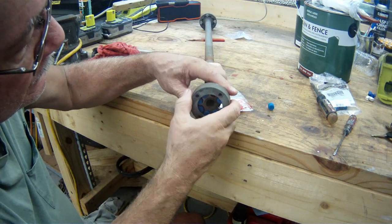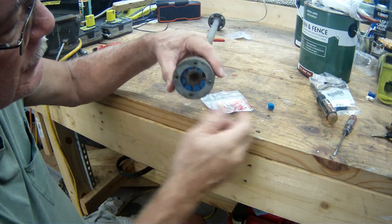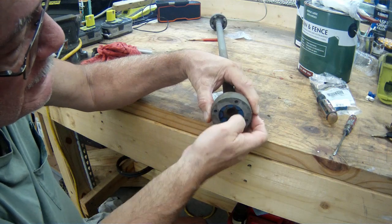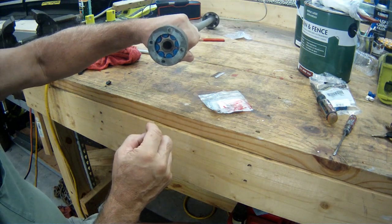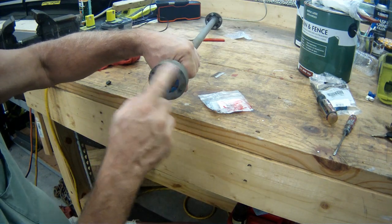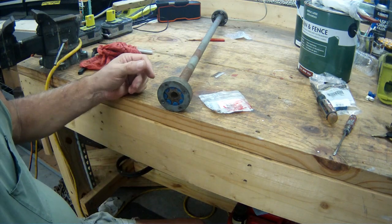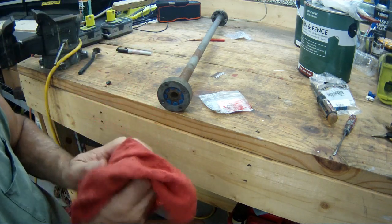So there's two left. I didn't want to put grease on the barrels — figured I'd just drop them. Take the barrel, move this collar forward, tip it a little bit, squeeze it in. There are little notches that hold these in place. And bingo — there are your new drive barrels installed. I've never done one of these before. This whole thing probably took me less time than setting up the camera — maybe about two minutes. Now I'm going to do the back side, which is identical to the front side. Then it'll be reassemble the entire tractor. But I'll be able to mow my weeds again.